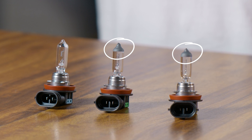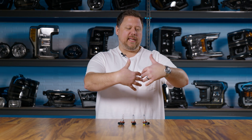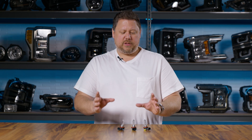If you're not an automotive lighting expert, you probably don't know what that little gray painted piece on the top of the bulbs is. It's actually a limiter for the light so that light can't shine out through the tip of the bulb. Fog lights and low beam bulbs direct light backwards into reflective surfaces, which bounce it forward to create the beam pattern — that's how fog lights work for the H8 and how low beams work for the H11. High beam is a little different because it doesn't have to control light as specifically to avoid glare for oncoming drivers, so they let all the light come out — some of it projects directly from the bulb itself and still uses the reflective surface inside the headlight.